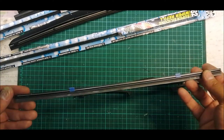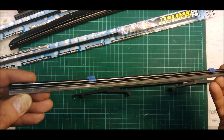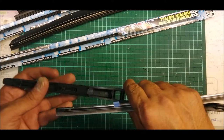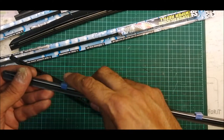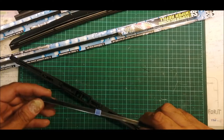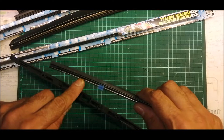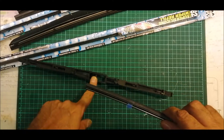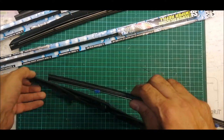This is the PIAA wiper blade. Okay, you can see they have written here original PIAA, 18 inch, and also the word PIAA. You are going to gently slide it in, and don't remove this, because if you remove this and you put in the blade, you will have difficulty in placing the steel plate together with the rubber material inside the housing of the wiper. So this is like a guide for you to put it in, and you remove it